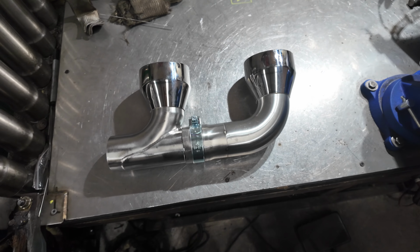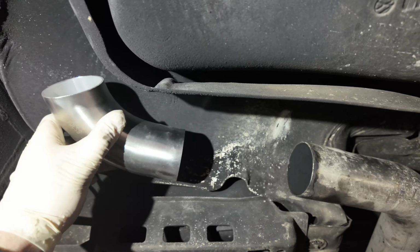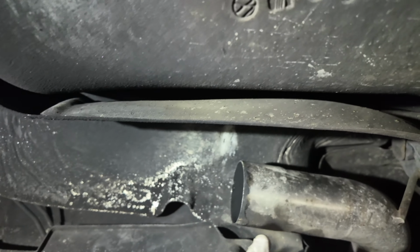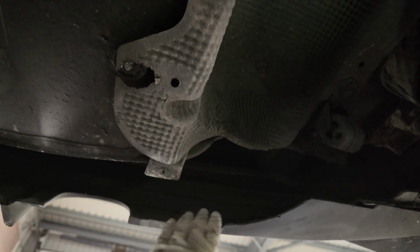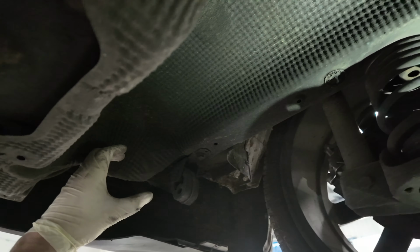Let's keep going. We've already done a million Polos and stuff before, so we know what's what. So here, basically there's a 75 degree bend. That wants to be 8 1/4 inches, because we're going to go over that by 2 inch clamp to that. And then we've got about 7 inch, I've roughly measured this, and a 30 degree. So the 30 degree will bring us up over the axle to about here. There'll be another joint here, and then we're obviously going to link into his other piece, as our R32 piece, what we're making, comes round here. We're about to trim the bumper out here a little bit, but that'll come round here. There's probably going to be a V-band in this area somewhere, and then the last stage of the puzzle will be to link that to this bit here. Hopefully that makes sense. If it doesn't, keep watching, and it will very shortly.